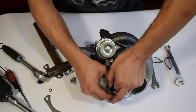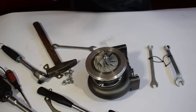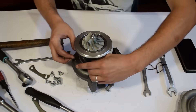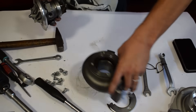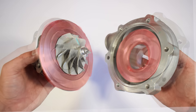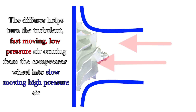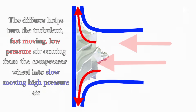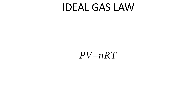To properly understand how the turbo builds pressure, we take it apart. Off comes the wastegate actuator, then the compressor housing, and finally the turbine housing, until we are left with nothing but the turbo core or cartridge. This part of the turbo housing and this plate of the cartridge play a key part in pressurizing the air — when these two parts come together they create the diffuser. The diffuser turns the turbulent, fast-moving, low-pressure air coming off the compressor wheel into slow-moving, high-pressure air.